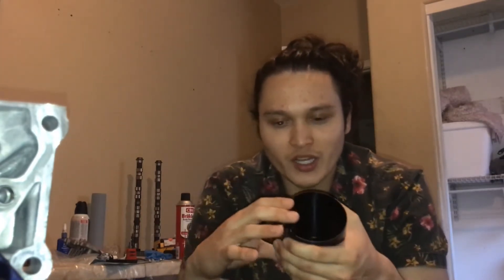I'm really glad I didn't get that into the cylinder because I would have screwed it up and would have had to re-bore it. Luckily I had that second set of rings - I just grabbed one of those oil rings and filed that one down to the correct gap. Then I tried it again. This time I looked up a few more videos on YouTube and really watched carefully.